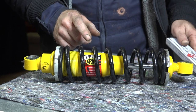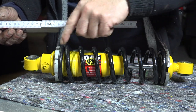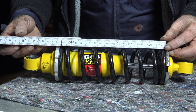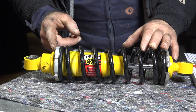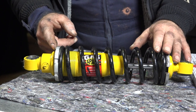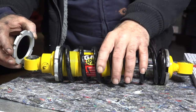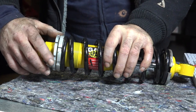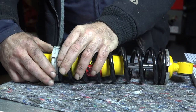There's an adjustment ring here that you can tighten up to make the ride more tough — the more you compress the spring, the tougher the ride will be. I don't know yet where to set it initially; I'll find that out while driving. I'm going to make sure both sides are set to the same distance. I'll measure from the top of this ring to the end of that one — 230 mm — so that's what I'm setting it to for now. There is a second ring, the locking ring, so the two push against each other so they can't move.